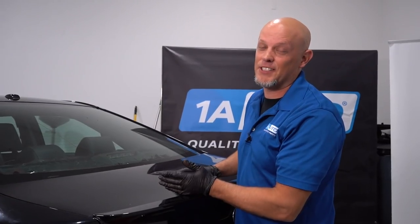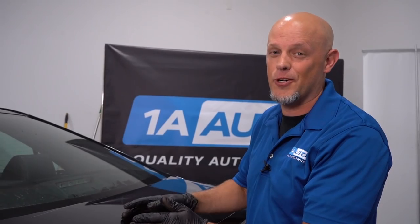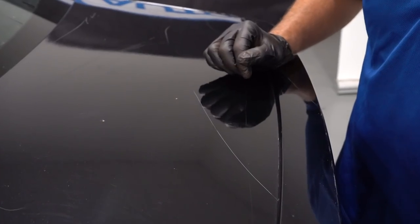This trunk has many different scratches, from lighter ones to deeper ones that are deep into the paint and can't be repaired. So let's go over how you determine which ones you can fix. For the most part, if you can feel the scratch, it's probably unrepairable.